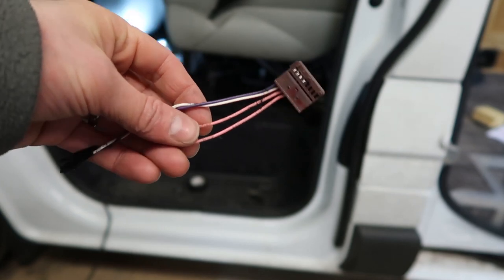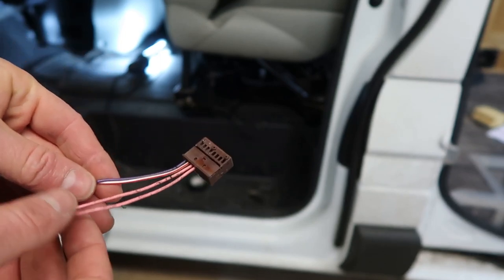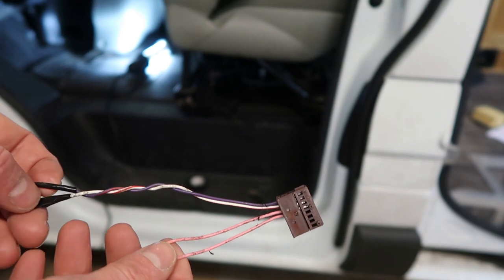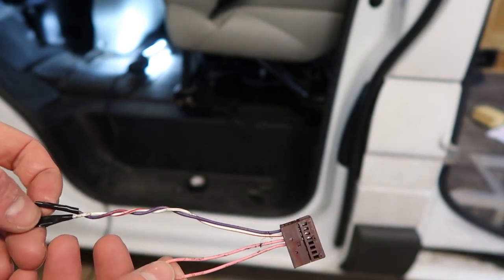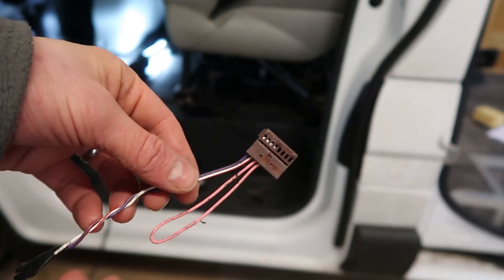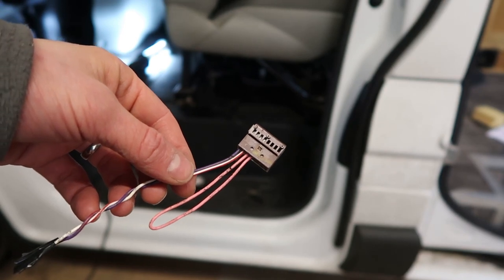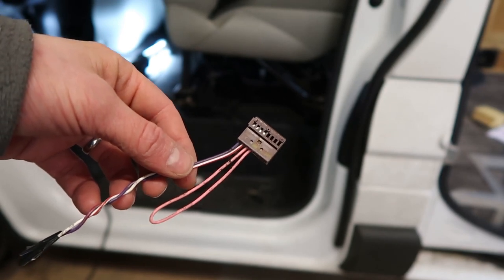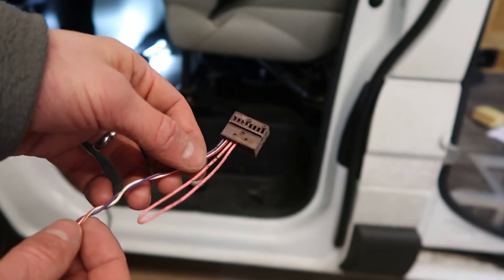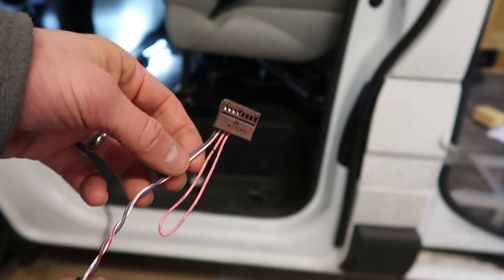Here's what was inside the harness wrap. It's a 10-contact plug but only four contacts are used. The first two contacts go onto the pre-tensioners — I suspect they're simply something like a 12-volt power supply when the tensioners have to fire. The other two contacts, contacts number three and four, are simply shorted. I've checked that with a multimeter and there's no resistance — it's about half an ohm or less, which is really just a measurement error on my multimeter, so it's not some special high-resistance wire. The purpose of that, I suspect, is to notify the van of whether the tensioners are plugged in or not.